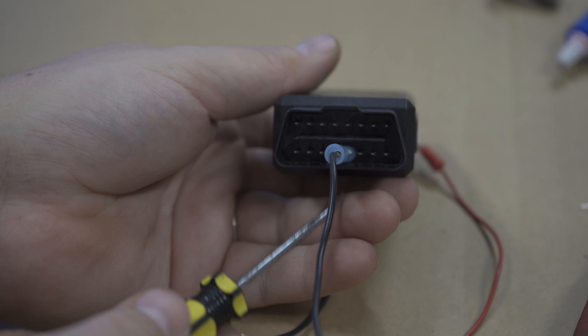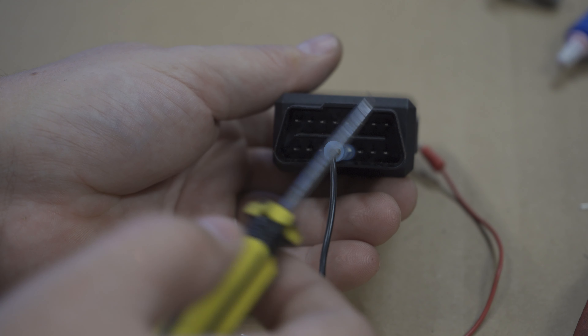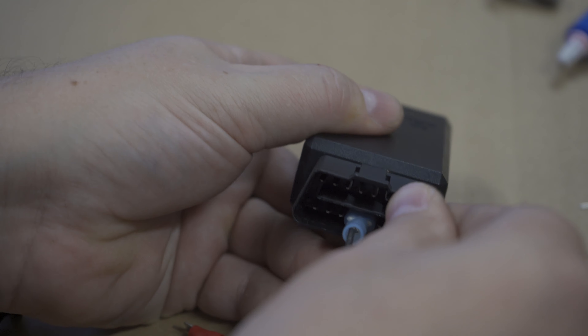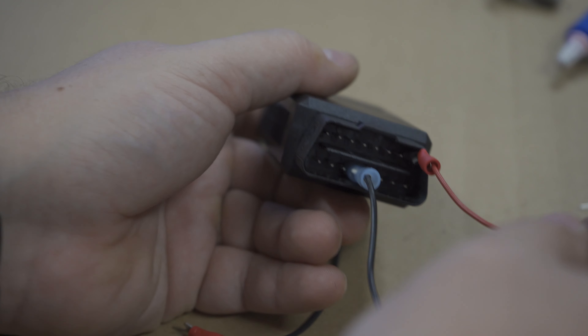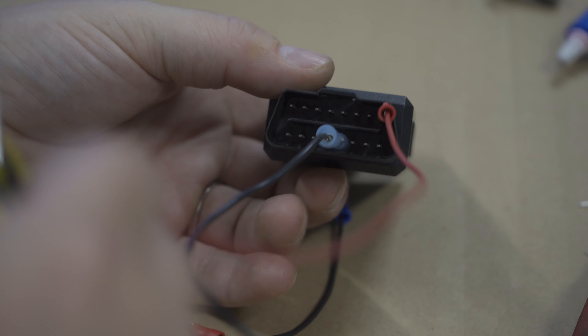And then on the other end I have the one from my male end. So on this OBD2 reader, we've got the back side with the ground facing down. This corner top right pin right here is your power. So what we want to do is take that end, connect it, push it on — just like so. So that's our power. That would be powering the OBD2, and this would be grounding it. So now we need the signal wire — the signal or the CAN bus.